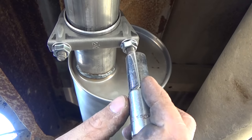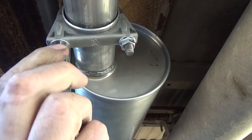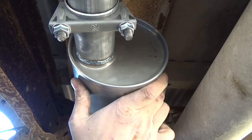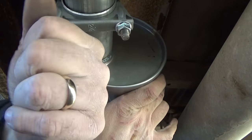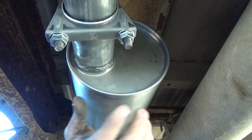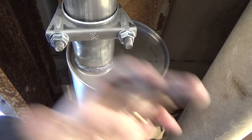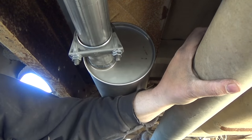One thing I can tell you about doing your own exhaust work: it's a good idea to wear earplugs — not because it's noisy generally, but because there's always a good chance of dropping something in your ear like a little clotted dirt or some rust. It's happened more times than I care to count. You can see there was a little sag in this exhaust — I want to get that sag out before I tighten it down. I'll reach under, give it just a little bit of a lift, and then tighten these up.